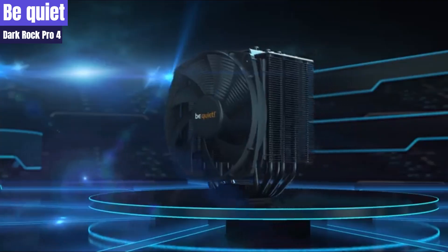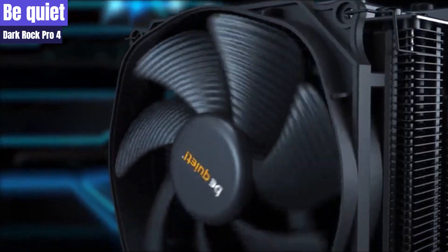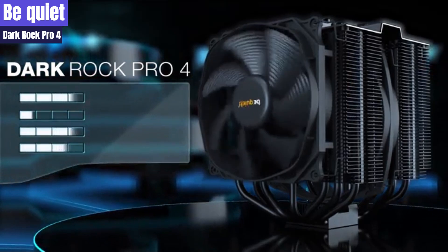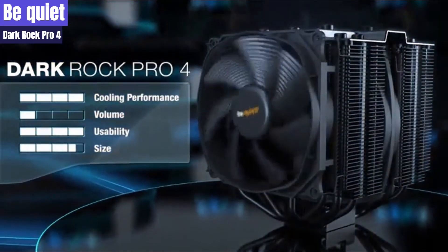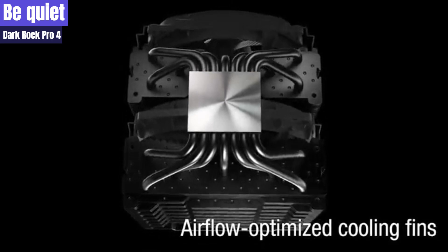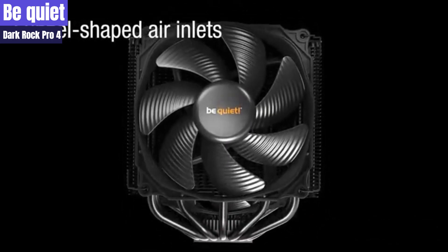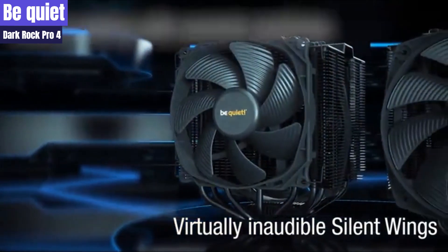This is more desirable than a single fan forcing air through one large cooling fin tower. The heat pipes collect directly below the center 135mm fan, capped by an aluminum mounting base that is polished to a near-mirror finish. The other side of that mounting base features a raised, almost heatsink-like, toothed formation. It acts as a guide for a mounting crossbar that secures the Dark Rock Pro 4 to the mounting plates during installation. The teeth provide fitment that also aligns with notched sections of the crossbar for stability.